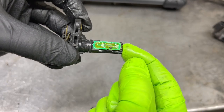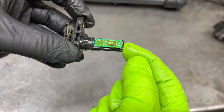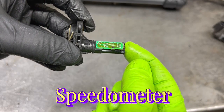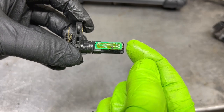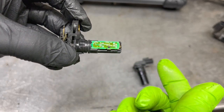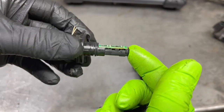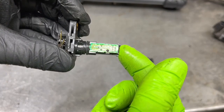That pulse — how many times that shaft passes the speed sensor — controls your speedometer. It controls shift points. It controls when the solenoid is to be excited and shift you to the next gear, and it all comes through these little speed sensors.